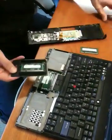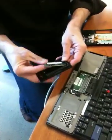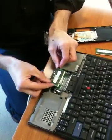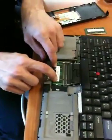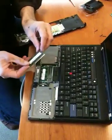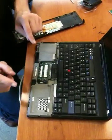Then you'll take the 2-gig that I gave you — it's got little finger tabs. Again, be careful not to touch the gold plating. You slide it in at about a 20-degree angle, and then it should just push down and snap into place — you don't have to force it. If you force it, you're doing something wrong. Then put the 1-gig back in, so you have a 2-gig and a 1-gig bringing you up to 3 gigs.